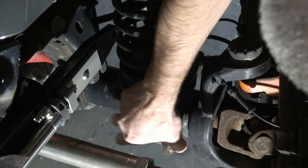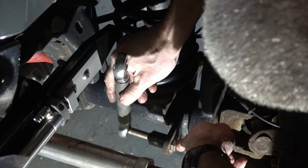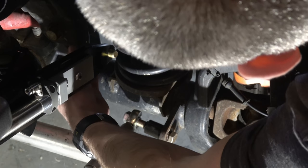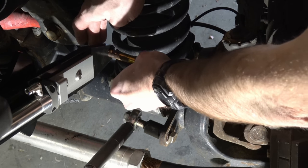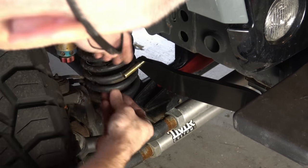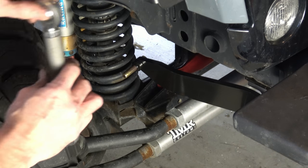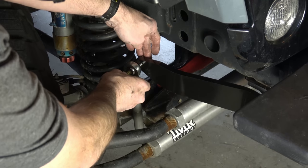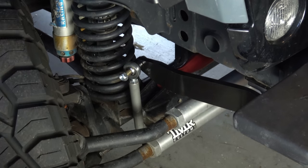Now I'm going to start installing the links. I'm going to set up the driver's side, but I'm going to completely install the passenger side first — the non-latching side — just so that I can make sure that the links are the right size for my Jeep. They're going to be close to being identical in length, but I want to make sure that they're perfect for my setup. I'm using anti-seize on these — bolts go through, then a little standoff spacer, then the link. So now I'm already on to the passenger side and I'm going to use the original tested length link on this side.